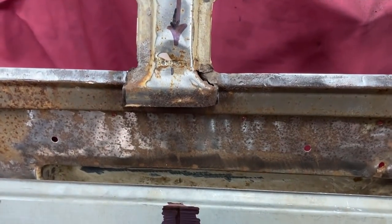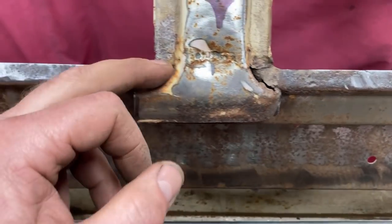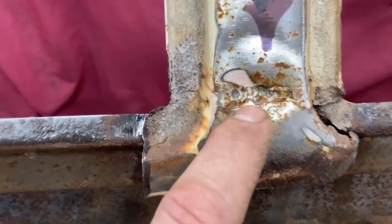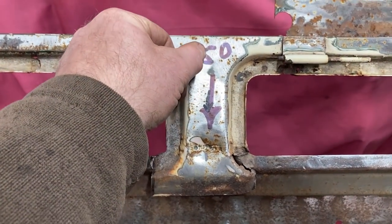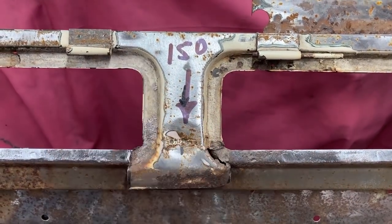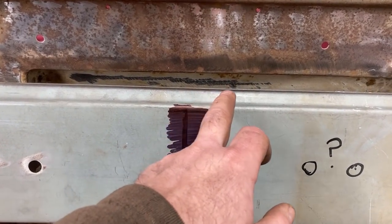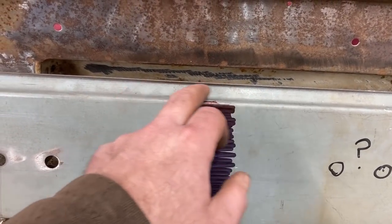As I pointed out earlier, this one's already crumbling here and that one I very much doubt has got much life left in it — it's very thin, and it had a load of gobbo in there where the original join was. I'll do away with that and just have a very tight seam down there, and somewhere around here and here. So I'll put a cut across there, clean that up, and it just makes fitting that piece quite a bit simpler. Because all I've got to do then when it comes to fitting the other piece is take that lip off and probably lap weld it onto that.